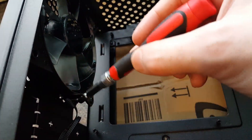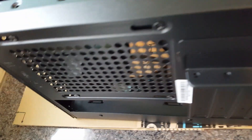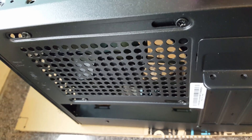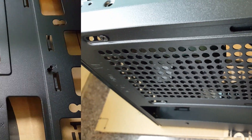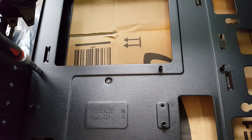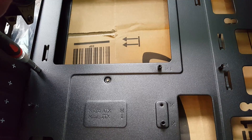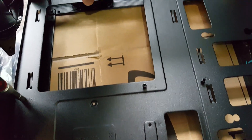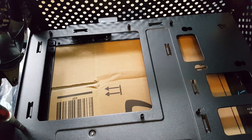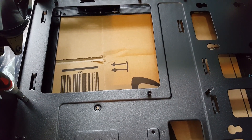I've come to this standoff here and the fan's in the way, so luckily this case has got four screws — I'll loosen them a little bit and push the fan out of the way. Some of these standoffs go in easier than others, so if you're not sure take it back out and try again. They should all be nice and flush with the case — you shouldn't be able to get your fingernail underneath them. But don't over-tighten them.